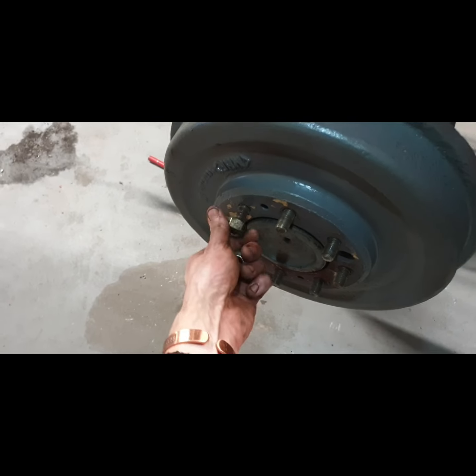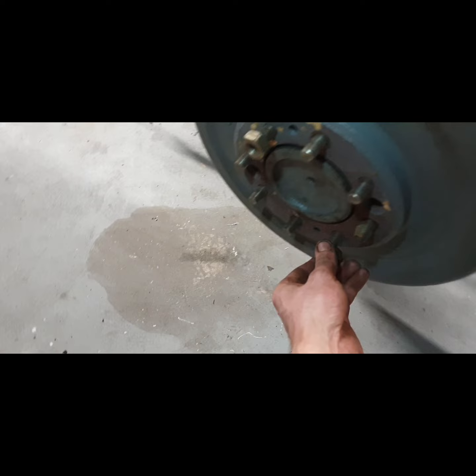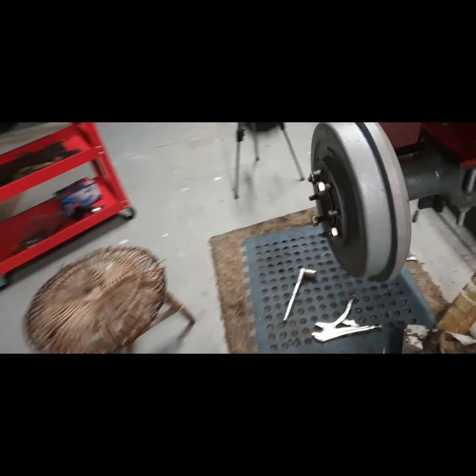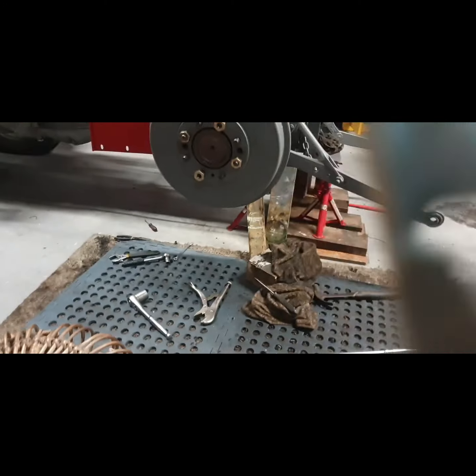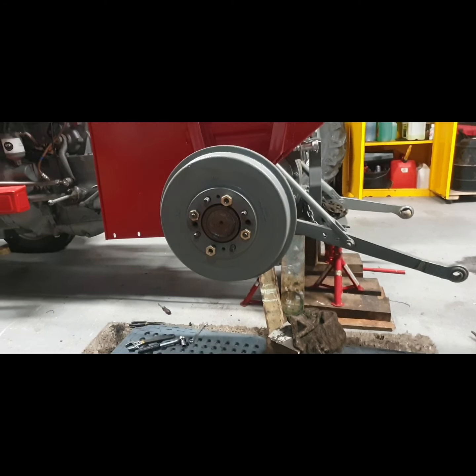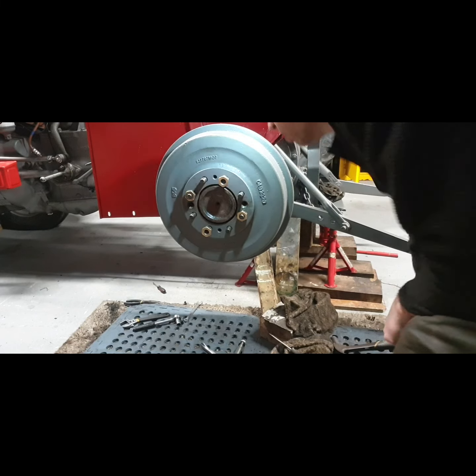So I'll go over the other side. Pull up our little catch, 2 clicks, get 2 more wheel nuts, use these then to grab the extension so we can do a little testing. We'll see 2 clicks. I don't usually expect a whole lot to happen with 2 clicks anyway. Mind you, on the other side 3 clicks and that parking brake had it locked solid, so that is actually, as I said before, the best brakes that I've ever felt and were adjusted.